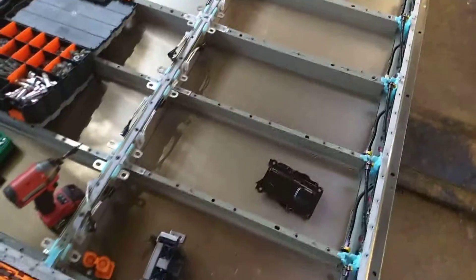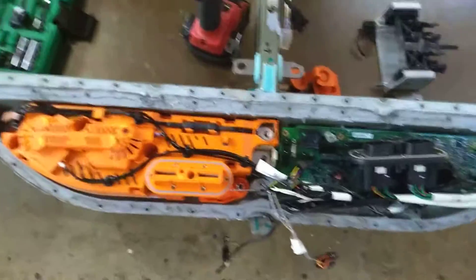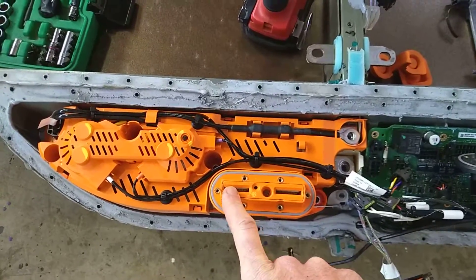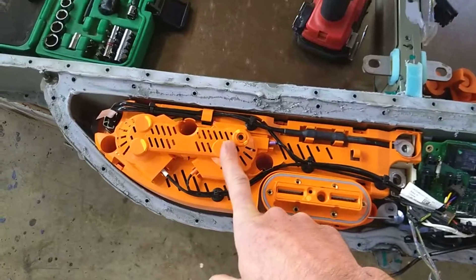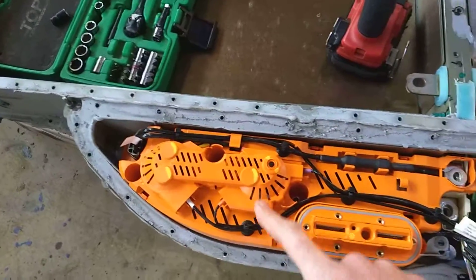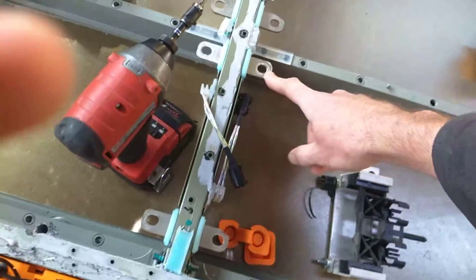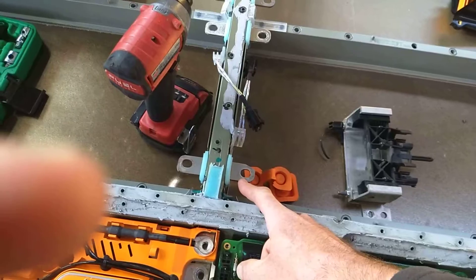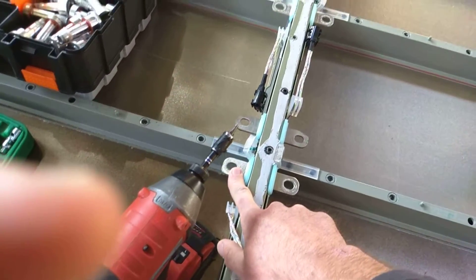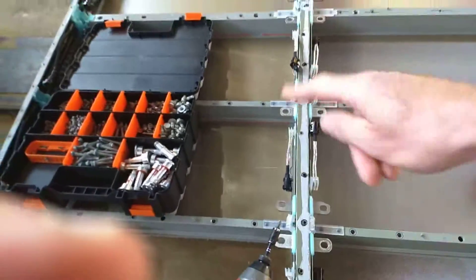They're wired in a funny way. This is negative — zero. It comes down to one of these, so you go zero or negative connector through a contactor. That's two contactors nicely hidden under an insulated cover there, into here, up to here — so that's zero. Then you get to plus 25 volts and go across to this one, then here — so that's now plus 50 volts, more or less. And then diagonally up, through this one, across, up and so on.